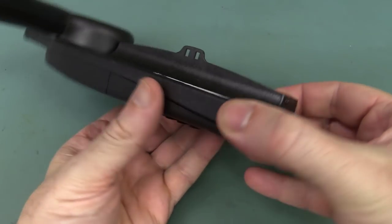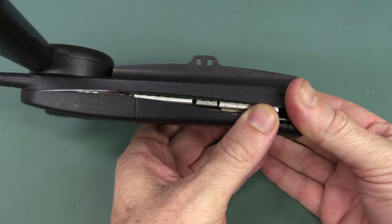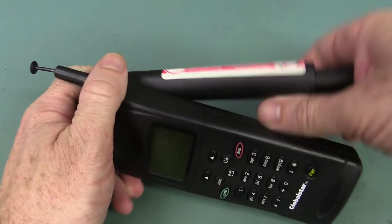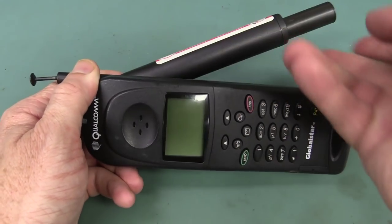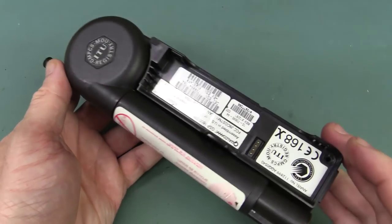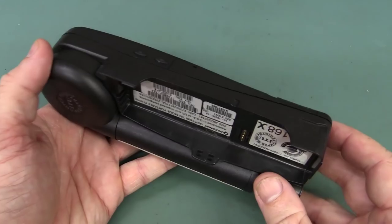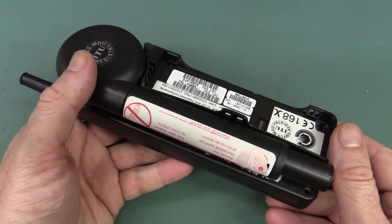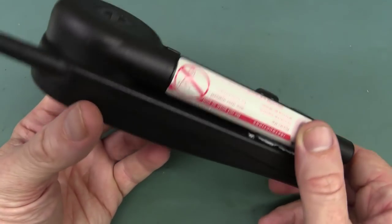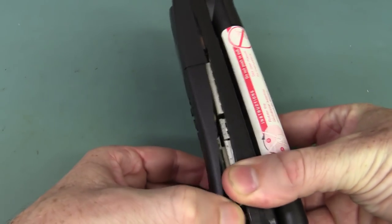Let's crack this thing open. There were a couple of Torx screws on the end, and I expected a couple of shielded cans — because this is going to be tri-mode, they'll have separate transceivers for the satellite phone. It's going to draw a fair bit of power, hence why they only turn it on when you flip the antenna up. It's actually not surprising this had almost a 10-year lifespan — they haven't got the consumer demand to keep redesigning every 9 or 18 months, so low volume means one design and they stick to it.